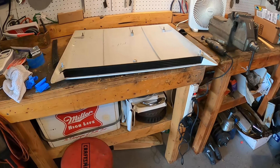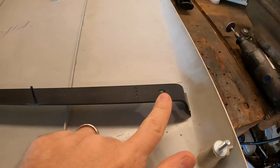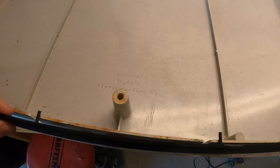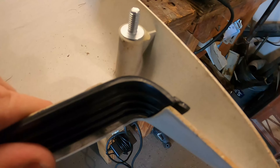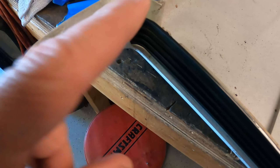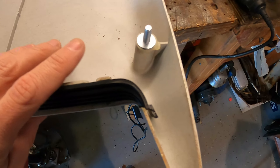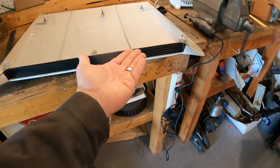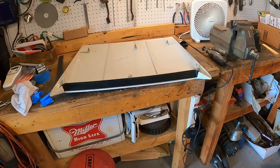Before putting this on the car, I tried MPD's insert again. I ended up snapping off the outer two plastic pins because they weren't fitting — the center ones actually fit and centered the piece, but the outer ones were way off. Snapping them off let me slide it in from the center. It puts it pretty close, though it doesn't fit perfectly into the lip on either side. For now until they send me another one, it'll at least hide the ugly white center. I'll put a little double-sided tape on it temporarily just to get an idea of the look.